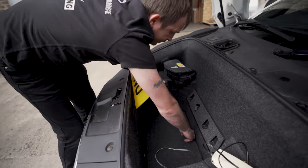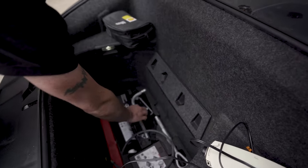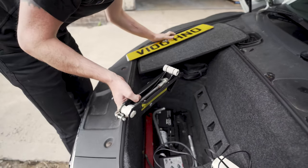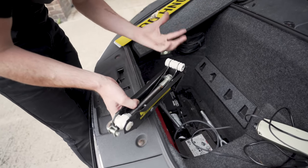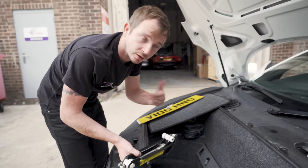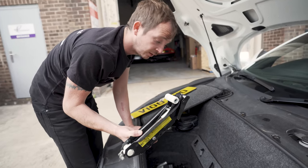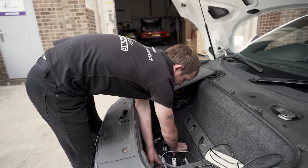You will have a toolkit with a jack. The jack has got a little post. There's a cutout in the sill that this sits through and sits into the chassis. So on eBay, if you look up R8 jack puck, as in ice hockey puck, it looks like a puck with a bulge on the top for that. So then you can use a normal trolley jack at home. Don't trust this. They're only to get you out of danger. Don't sit at home and take your wheels off and stuff, because they're not brilliant.